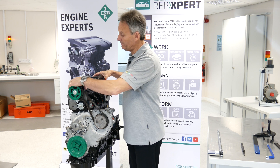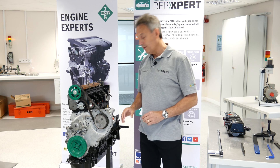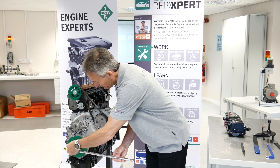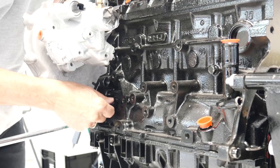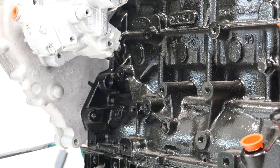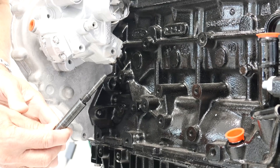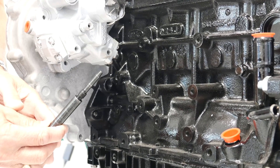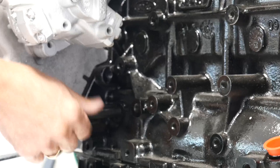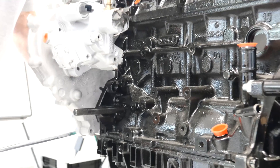I've now got my engine at ambient temperature and I've put it in a position just coming up to top dead centre on the crankshaft. We're now going to fit the locking and locating tools onto the engine. I'll remove the blanking plug from the block and fit the crankshaft locating pin — note it's a tapered pin, just for the crank to come up and touch against so we know we have it in roughly the right position. We screw that into the block all the way in, then turn the engine over clockwise until the crank rests against the pin.